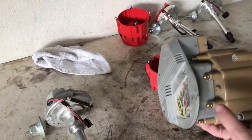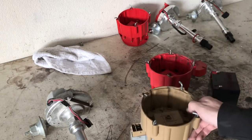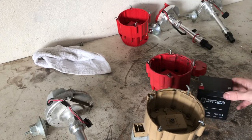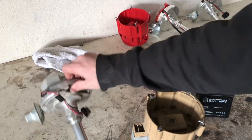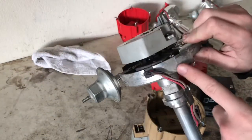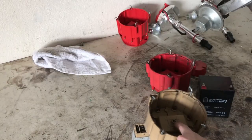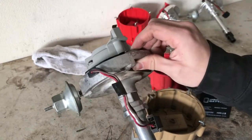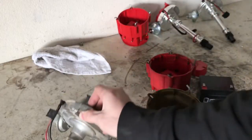There's a coil inside of this cap, so how we're going to check that coil is we're going to hook it up to a 12 volt supply, run a ground from the distributor, and run a wire up above. When we spin the distributor cap it should spark — if it doesn't spark, the coil has gone bad.